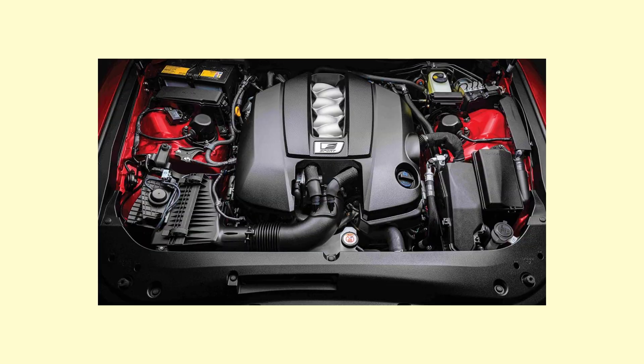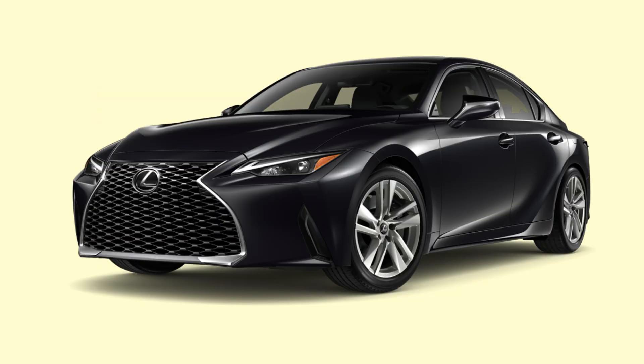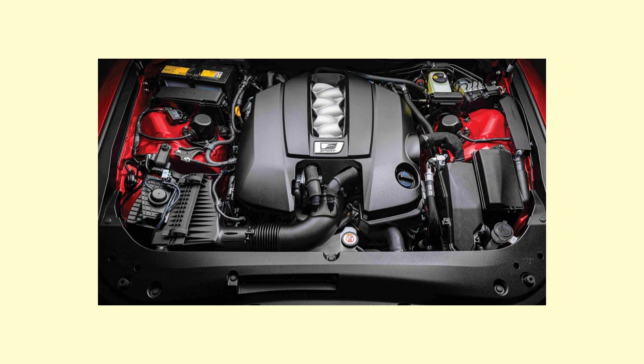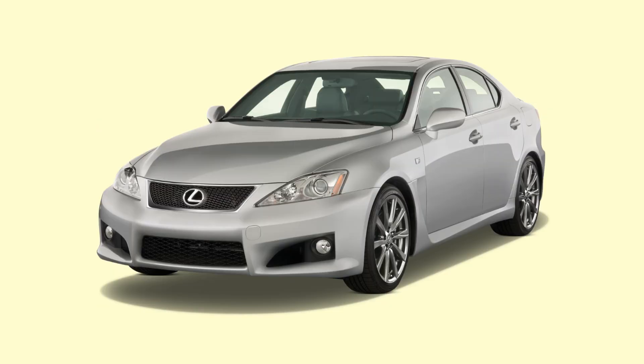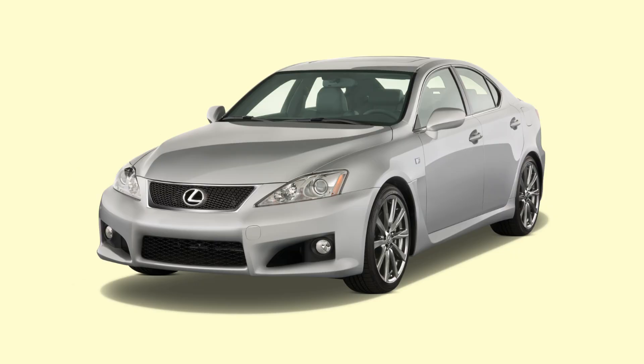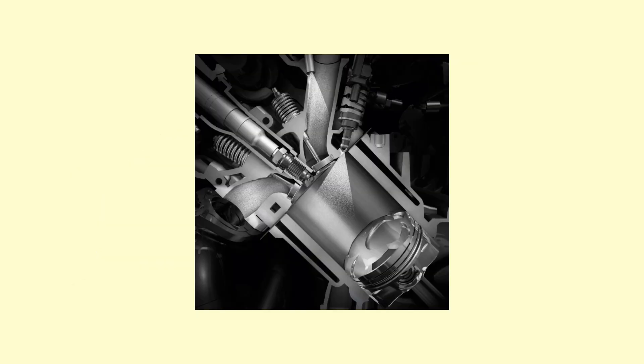Let's list a couple of minor changes. To accommodate the engine into the new 2021 IS, the hood has been raised nearly 2 inches and receives sculpted centre character lines, while the front bumper and fenders have been lengthened. While the 2UR-GSC for the Lexus ISF had a compression ratio of 11.8:1, this was increased to 12.3:1 for the IS500 to accommodate the extra 55 horsepower and 34 Nm over the ISF.